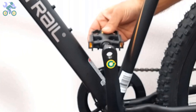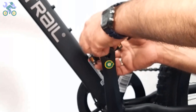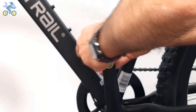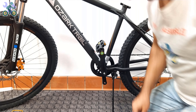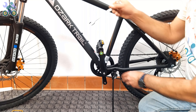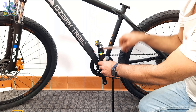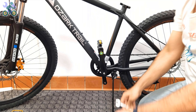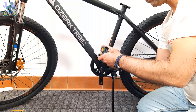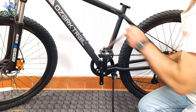If a pedal won't install on its side, go back and install it from the inside of the crank arm in the opposite direction toward the rear of the bike — this is done when the pedal or crank thread is damaged, as reversing the installation direction will help rebuild the thread for proper installation. After installing one pedal, repeat the same process for the opposite side. Always install pedals turning toward the front of the bike. If your wrench gets stuck after tightening, push the wrench toward the outside of the crank arm and release.